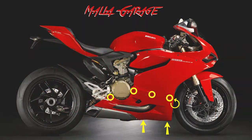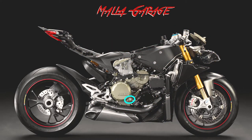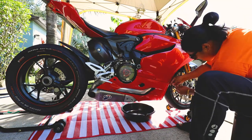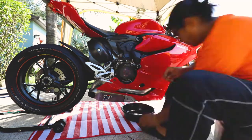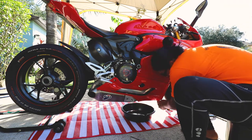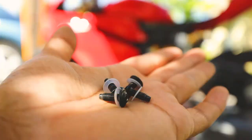Now I'm going to take out the right side lower fairing using the same allen wrench — 3 millimeter and 4 millimeter. There are a total of seven bolts, highlighted in yellow. You really don't have to remove the right side lower fairing to change motor oil; I'm removing it in this video because there's an oil level indicator located on that side.